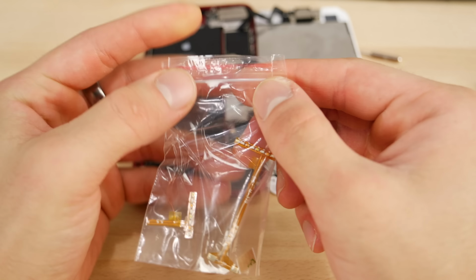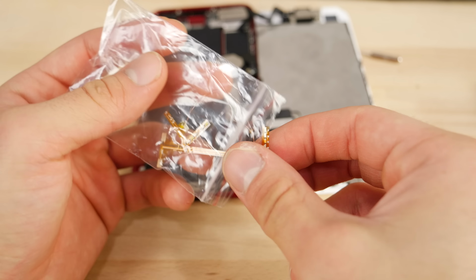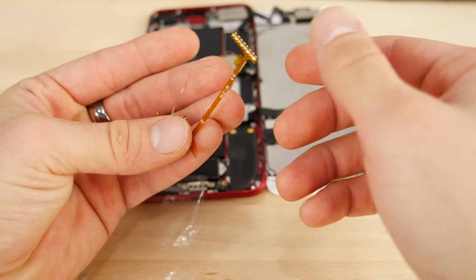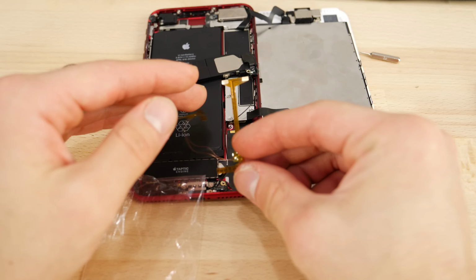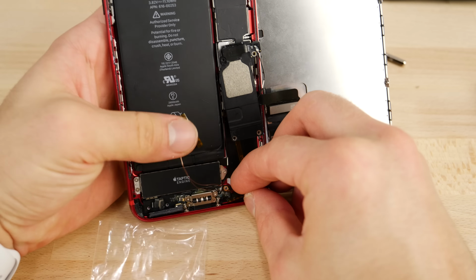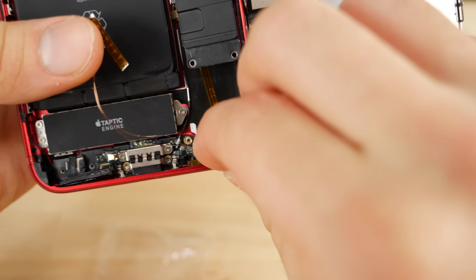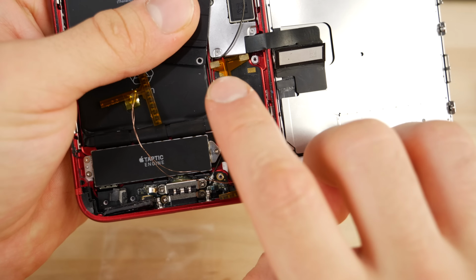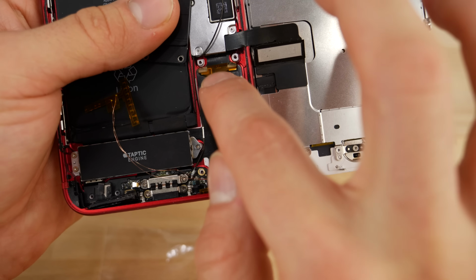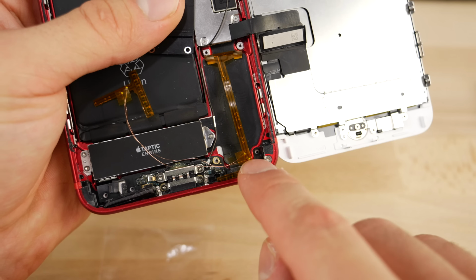All right, so what you're gonna do now is go ahead and remove the LEDs from the package. And this process is pretty simple, but you still wanna be very delicate, take your time. These wires are very thin, separating the two LEDs, so I would be very careful with them. But basically what we're gonna do is we're gonna nestle the LEDs perfectly into the slot. It's gonna be kinda hard to show, but we wanna pop them down in there, and they'll fit nice and snug once they get into the speaker holes. And you're gonna plug this connector in right here and tape it down with the little tape strips they give you in the package. And you wanna make sure it's very snug, sitting exactly on the connectors, as that's the power source right there, and do the same to the other side.